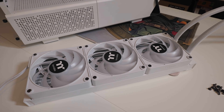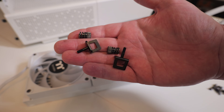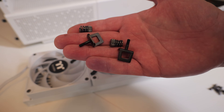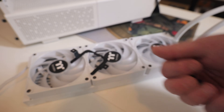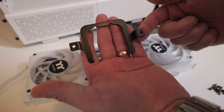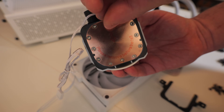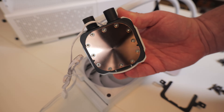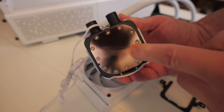Now we can concentrate on the mounting mechanism for the CPU. To set up the pump head for AM5, AM4, or other AMD platforms, you'll need two of the spring-assisted tightening screws, the two metal brackets, and also the U-shape clamp with two holes — one top, one bottom. When you're getting ready to install, make sure you remove the plastic film, otherwise your temperatures will be absolutely awful. If you want to, you can use a little bit of IPA cleaner to wipe any residue off, although in my experience there's very little left.